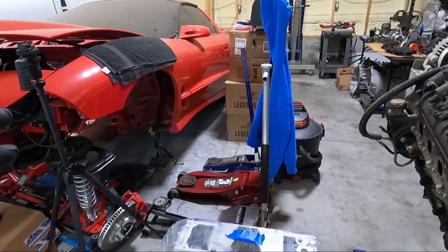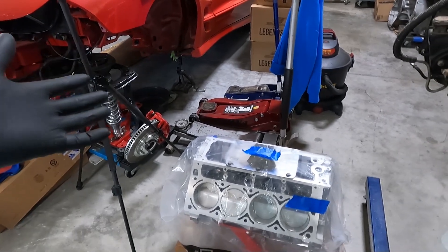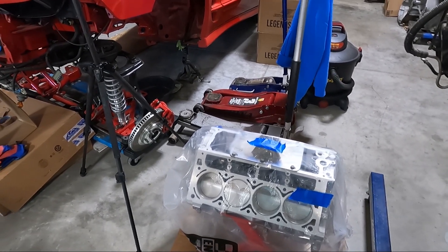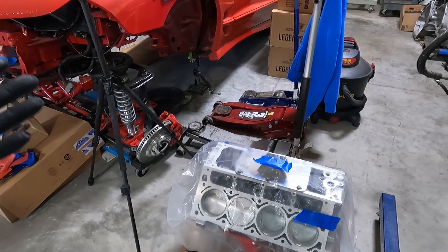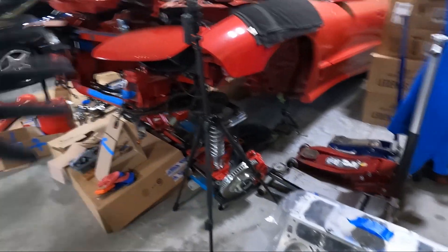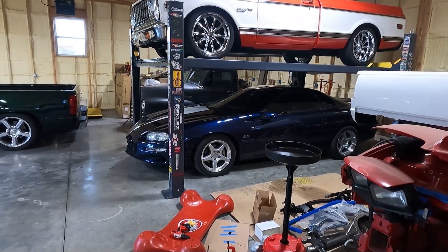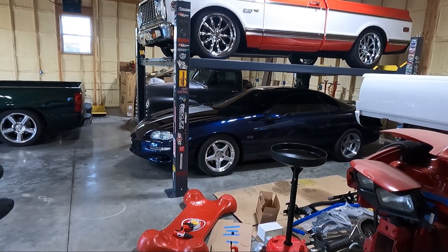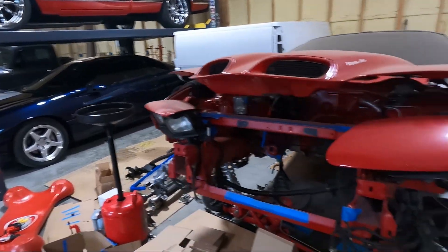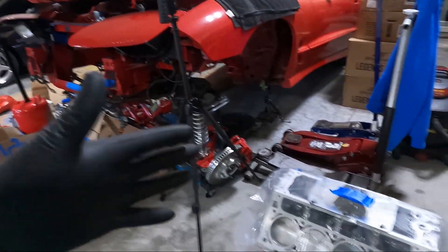That motor has been sitting on a stand, finished and ready to go in. It wasn't really spec'd for turbo — just a 228R cam with LS9 head gaskets and ARP bolts, sitting there while I waited for parts or motivation. Along comes my son's car. As you guys saw in those videos, we pulled it apart and took all the turbo stuff off. That motor was trashed — all the rods were bent, pistons were bad, bearings were no good, rings were bad. You name it, it was bad. So we put my motor in his car, knowing I really wanted a stronger build.